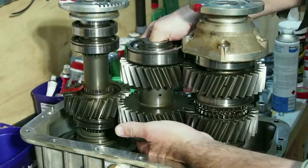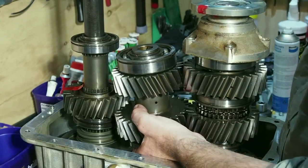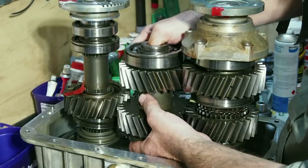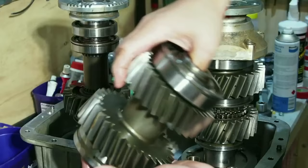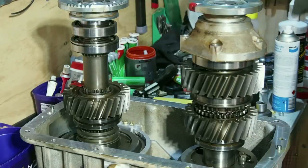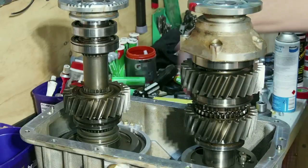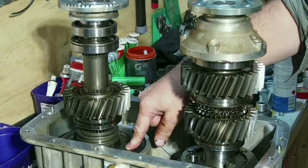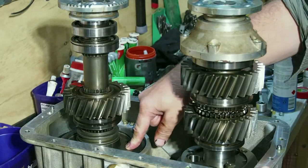It's really basic. The hardest thing to get your head around in this transfer case is how you've got a shaft within a shaft, but once you nut that out it's pretty straightforward. When you look at an exploded diagram it's hard to see that. The centre diff is the same type used in any car that doesn't have a 50-50 front-to-rear split - a Subaru would have the same type of centre diff. The high-low range planetary gearbox is unique to this and a Model T Ford.